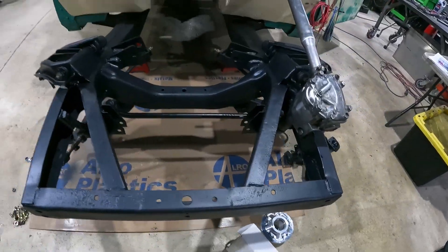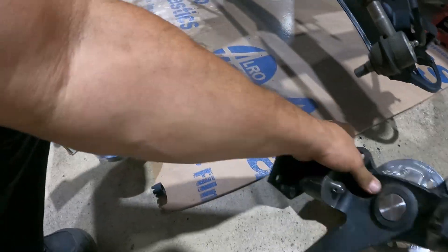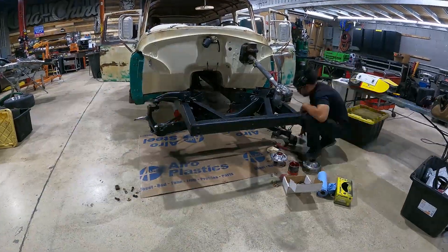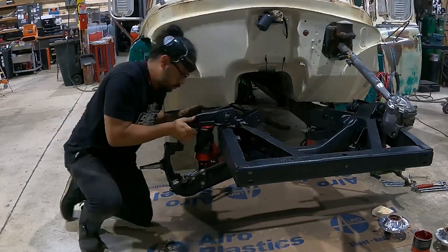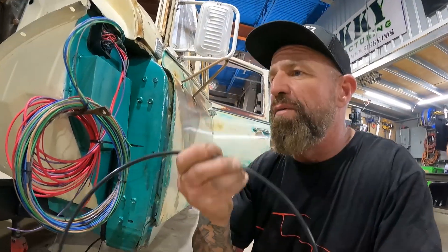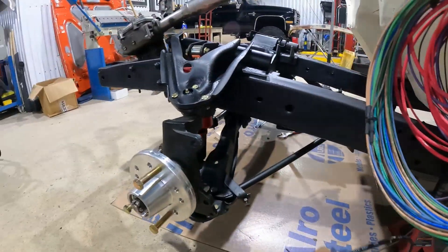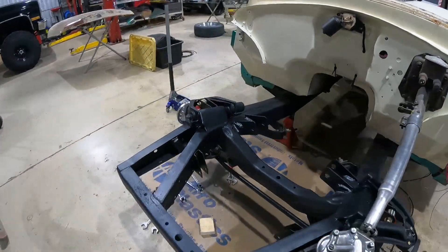It's time to put the front suspension back together on the Travelall. We've got our knuckles machined to fit our international ball joints — we brought these to JC and he cut a new taper in for the ball joints. These are C10 knuckles from CPP, retrofitted to fit on the front of our international. Sean's getting all the wiring done for the air management. The last thing is running quarter-inch lines supplied by Airlift Performance to our front and rear air shocks, attaching them along the frame rails from front to back, nice and tidy.